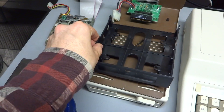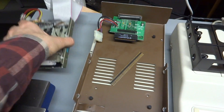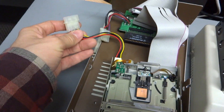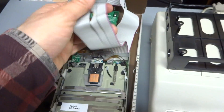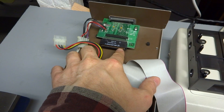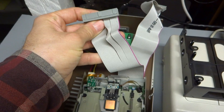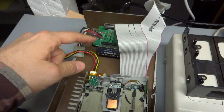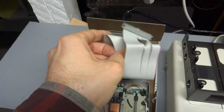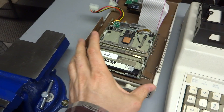All you have to do is use something like this, which is an adapter for a floppy drive, and you can connect it straight up. Here's an old floppy drive I have. You'll need one of these power adapters, and you can just use a normal floppy cable. The way this is wired up, the 5.25 inch drive connects right into the slot connector — that means it's a straight through. A regular floppy cable has a twist, which is normally for the A drive. But because this board is wired for a straight through, you use the straight-through part of the floppy cable and connect it up. You can absolutely put one of these floppy drives into the mounting brackets, close the case all up, and it looks perfect.